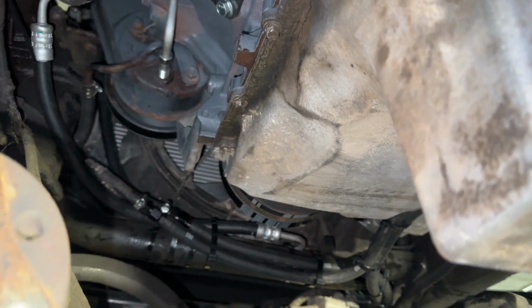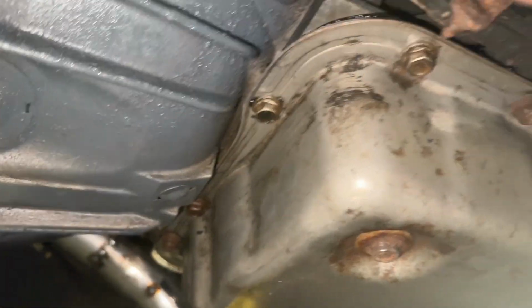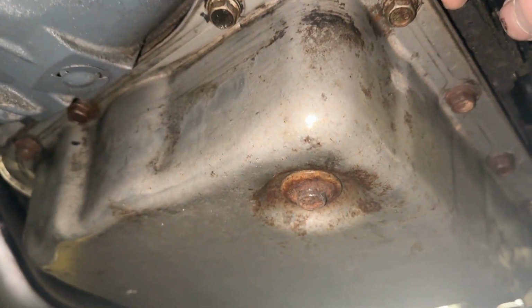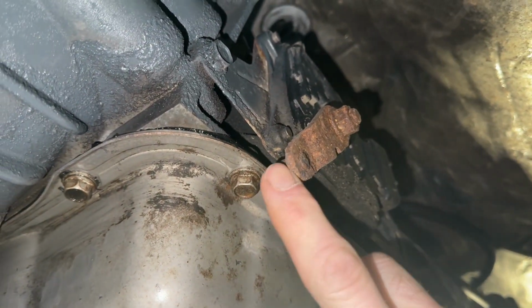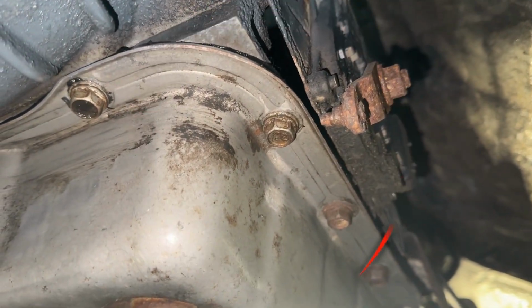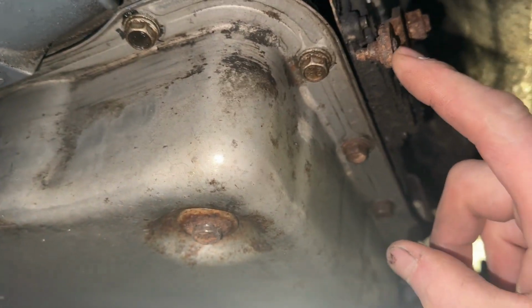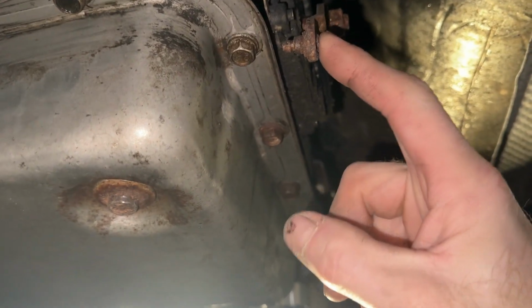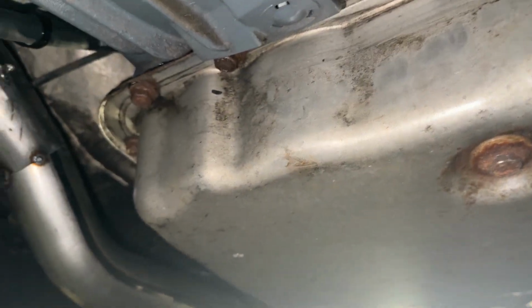The only thing not done down here right now is drive shafts, but you don't do those till you hit the ground and then measure everything out. Yeah, 4-wheel drive bracket. And then this little guy, I'm gonna take this guy off, sandblast this, but sometimes on these, when you use the cheap cables, they like to twist. The cables will twist, and it will continuously pop off of this little nipple there. Just inherent in those cables. They just have an inherent twist in them, and sometimes they just do not want to stay on here. So if you get a situation where you've got a cable that keeps popping off, grind this out, put a 1/4 bolt through it. Won't ever have that problem again. I slap a little grease on it and snug it up with a lock nut, and away she goes.